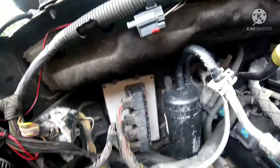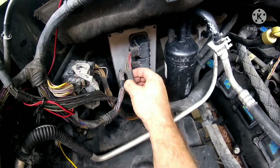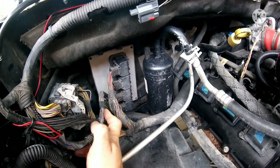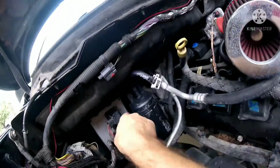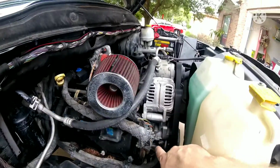And what I'm thinking here is it's gonna go into one of 2, it looks like. Either this one or this one. These 2 are connected separately through something else. But anyway, I gotta match these colors, these wires. I'm gonna find out what pins go to what. I'm gonna ohm them out or check the continuity. I'm gonna see if there's a break in the wire somewhere, and we're gonna end up doing that today.